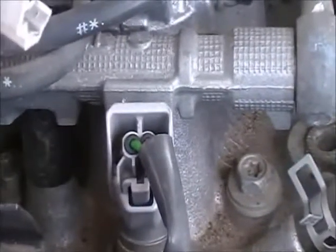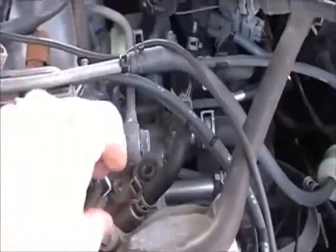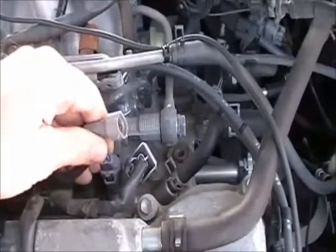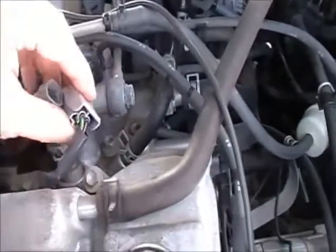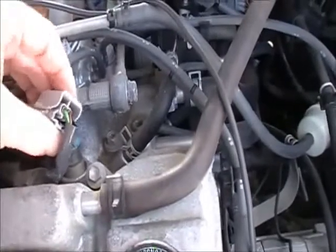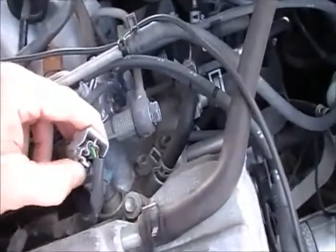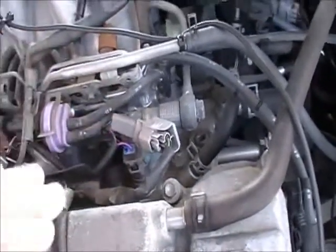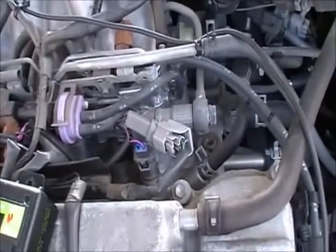Right there is the fuel injector cable and I'll remove it. I remove it and then I connect in the identical mating connector from the emulator cable — snaps in place. Then this end of the cable looks just like the fuel injector, and this connector connects into this one. So that actually interfaces the relay from this module to the fuel injector, turns them all on and off at once. They all get disconnected when it goes to CNG, and they all reconnect when you switch back to gasoline.